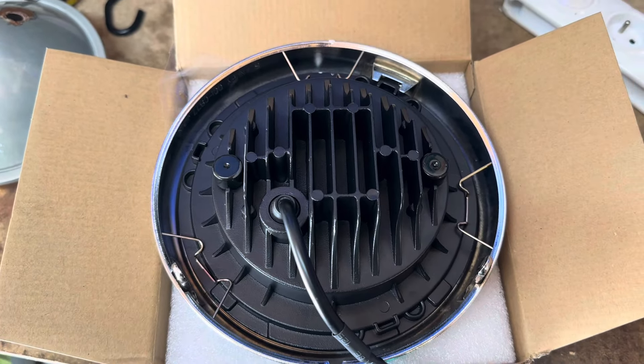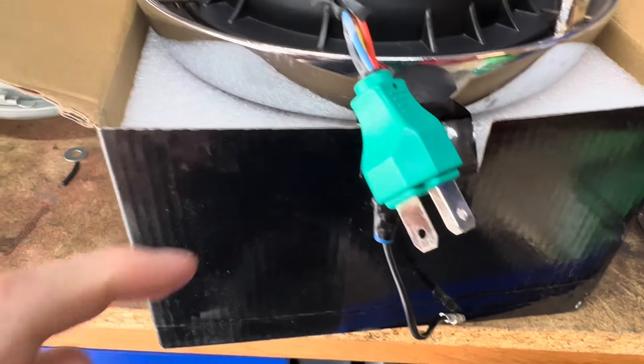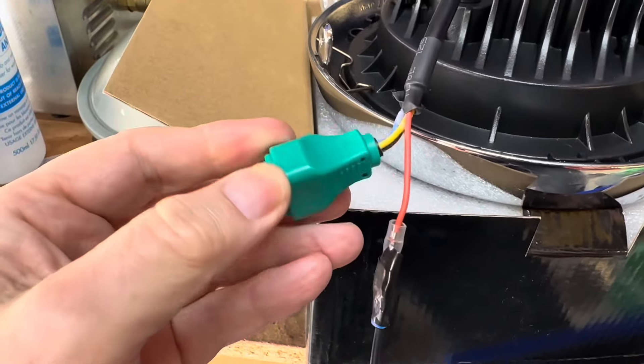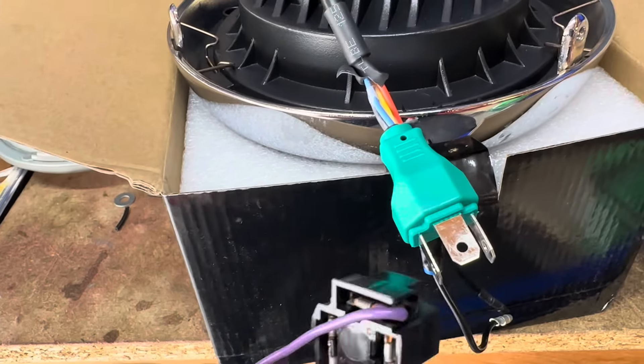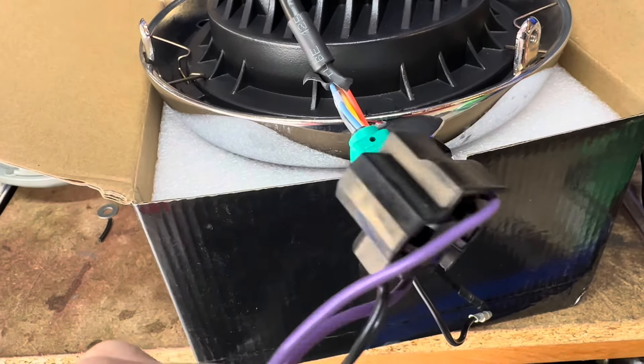Putting those clips in was relatively painless — I didn't trap my finger, and I didn't lose one across the garage floor. I started to peel back the PVC casing on the wires with a view to cutting off this green plug, but I did wonder whether or not that might have contained something like a ballast resistor. So in the end I decided not to do that, but to go down to the local scrapyard and pick up a halogen H4 bulb plug from a car, and solder that into the loom to simply plug it into the LED light. Here are the original Kawasaki wires — I've cut off the male and female connectors and soldered them onto the scrapyard H4 bulb holder, then protectively wrapped those solders. It then goes back into the standard Kawasaki harness.